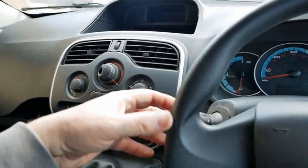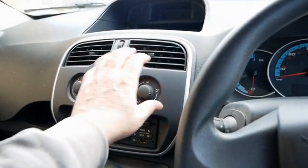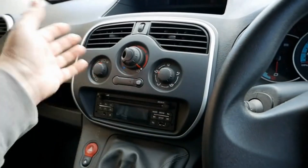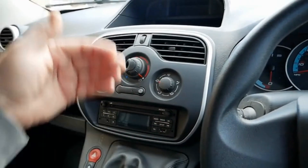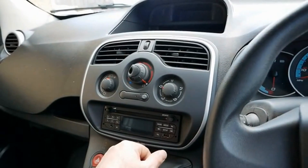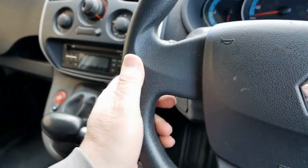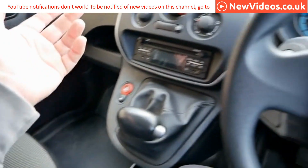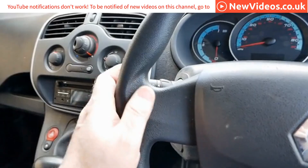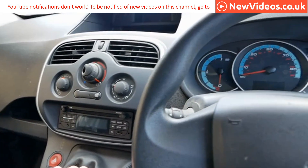So in the winter you're consuming more electricity because of the heater use. Anything you can do to minimize that heater use maximizes your winter range, and that's why electric vehicles have this pre-conditioning function. They get the vehicle warm before you leave while it's still connected to your charger. A lot of electric vehicles also have heated seats and heated steering wheels as they're more efficient, though those are rare in vans. But all Renault Kangoos do have the pre-conditioning function as standard.